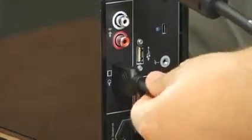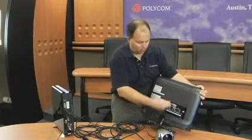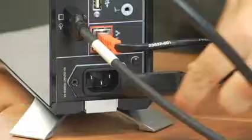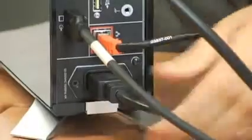The included HDMI cable supports both audio and video, so you will not find traditional RCA cables for audio in your kit. Take one end and plug it into the HDMI output on the HDX6000, and the other end goes right onto the television. If you have an older TV it may not support HDMI, but all new HD monitors definitely do. Your final step is to plug in the power cord — one end to your HDX and the other into the power outlet. You're ready to fire up your HDX6000.